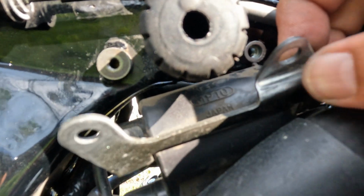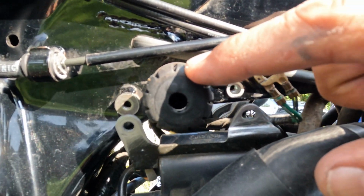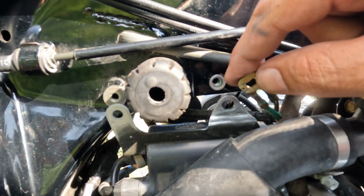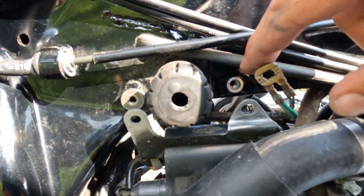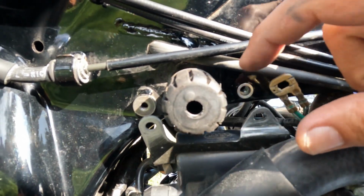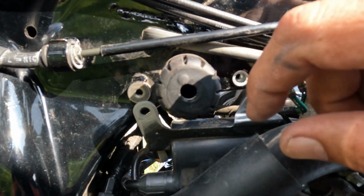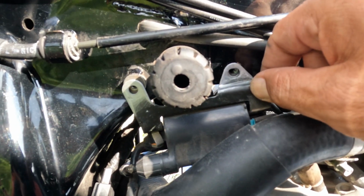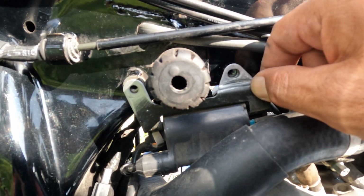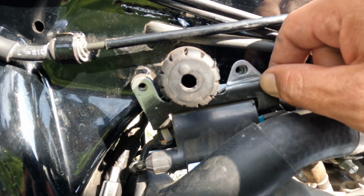Now I'm going to go back over these, make sure it's all ground down to the metal, put all of this back on, make sure this is ground in, and then the most important thing is going to be getting dielectric grease and getting that all over here and all over this stuff, even around where you scraped. Don't worry about making a mess. This is going to protect you from rusting, because you scraped all this protective stuff off of here. So this is pretty much going to be an ongoing maintenance thing if you own this bike.